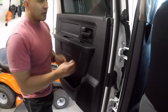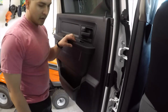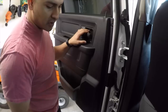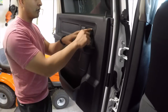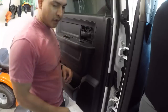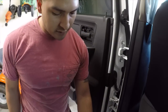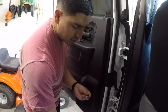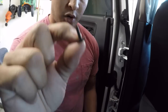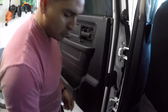Let's get started. Using the T20, you're going to remove five fasteners. Then unclip a small portion and you'll find a screw — loosen that to remove part of the door trim. I went ahead and removed that portion. There's a small plastic screw that secures into the door. Here's what the fastener looks like — just a small plastic clip. Remove that and set it aside.